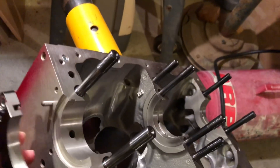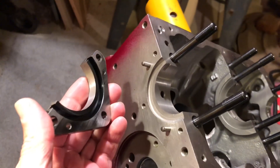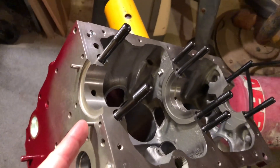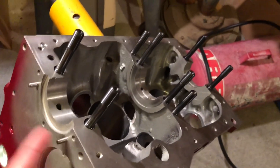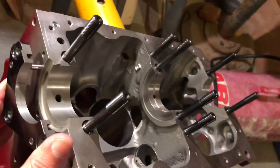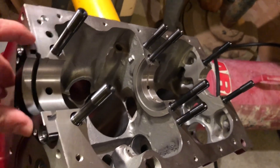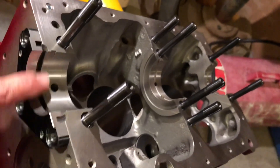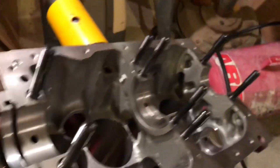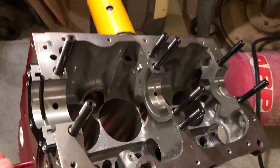Notice the two dowels. Now, it's not one of these things where someone took it off when disassembling the engine, or the machine shop took it off when they went to clean it. I've had to give specific instruction even to my machine shop that I've used for 30 years: don't take this plate off when I'm not line boring. This one lets you remove it by having these dowels in place - you always achieve the perfect fit, the perfect line bore matching the main bearing bore from the actual line bore when this was bolted up. The dowels give us the convenience of being able to clean, remove, and reseal as you go to rebuild these. Nice trick.